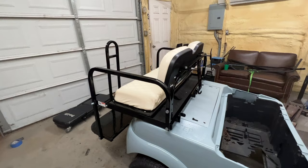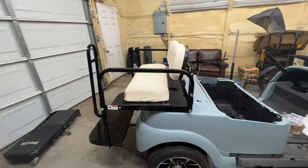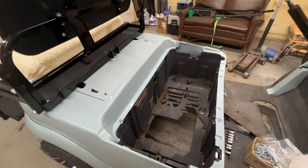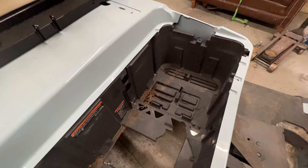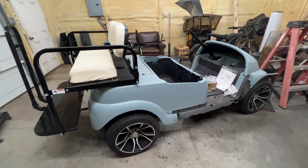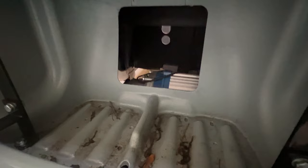I haven't decided on the roof yet because I have an extended roof getting painted — hopefully it'll make it in time. I have the front seats and covers to do later in the video. Next I need to work on the battery box area — installing the controller, battery, and all that goes with it. I'm running the Uno 90 amp-hour lithium-ion battery paired with a Silverwolf T-con motor and controller. You can see that motor peeking out down there.